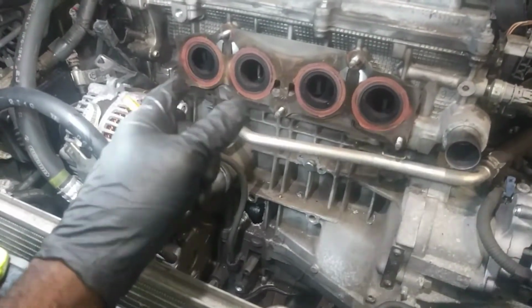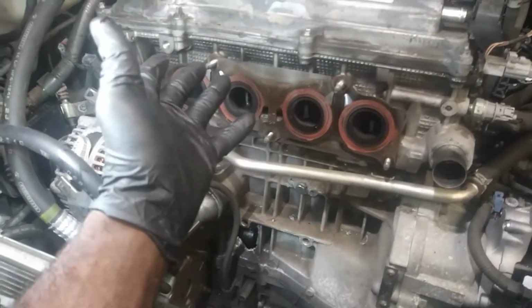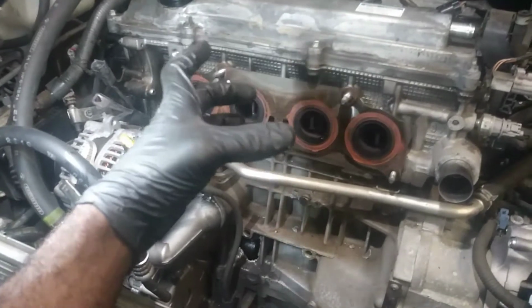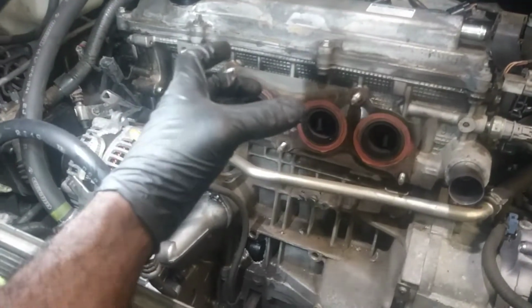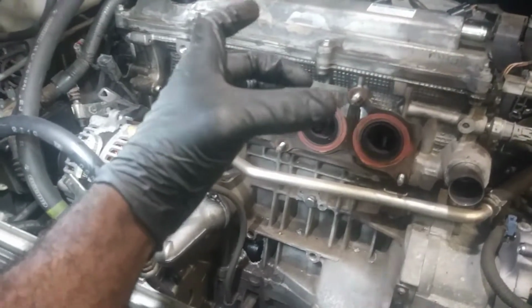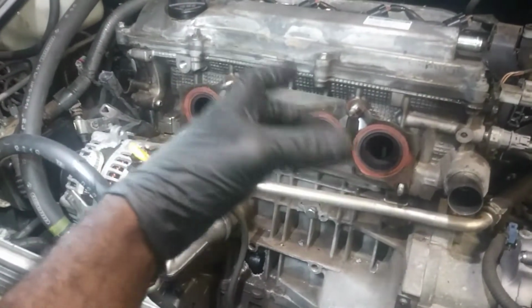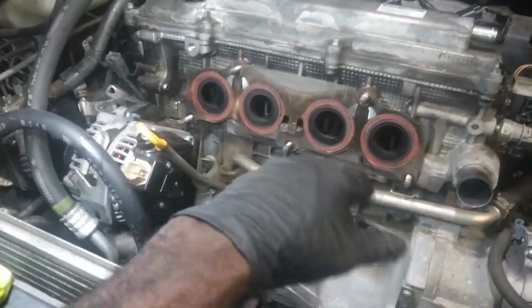Likely, what I'll visually see when I pull everything out is I'm pretty sure the journals will be fine on the cam. The top end should be okay. The piston oil rings should be essentially built up with sludge and collapsed. They wouldn't protrude from their ringland like the piston ring would. They wouldn't freely expand out and have good mating contact with the cylinder walls. So when I pull the pistons, those pistons should be seized up, and if you rub them vertically, it would feel as though they're mended with the cylinder wall clearances. That's what I'm thinking, because that's normally what happens.